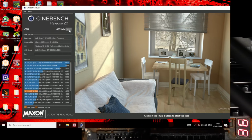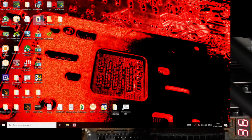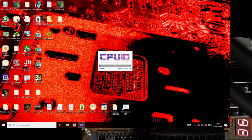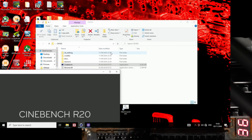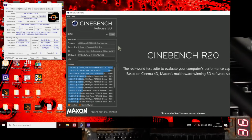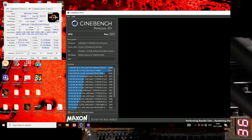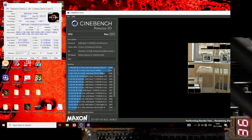And we're slower. We're even slower. So basically, yeah, do not negative offset the 5700X3D. Just don't. The only thing that happens is the CPU gets progressively slower. If you thought the 5700X3D was too slow, you can make it slower by lowering the core voltage. Oh, that's interesting. It's reporting 3.9 gigahertz, so it's clock stretching like crazy.